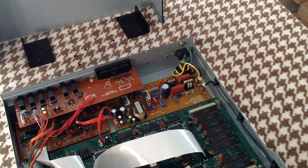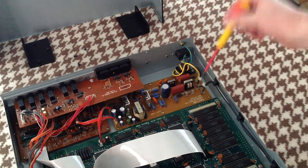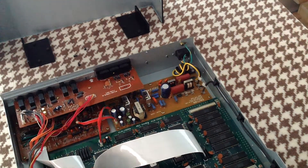What I did was go and buy an old unit that wasn't working and had been cannibalised by a previous owner. I picked it up off eBay for about £10 or £15. I took out the 240V board from that unit, put the board in here, and it's really a simple process — so don't feel it's something you can't do yourself.